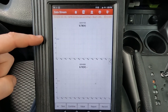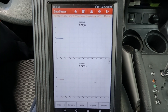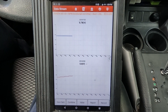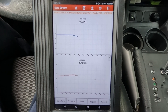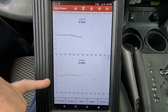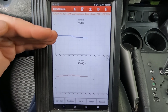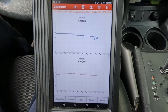Right now they're right where they should be at idle. Let's graph this for a visual. We're at 0.78 volts on top and 0.74 volts on the bottom — perfectly within range. Nice and flat. Let's go ahead and give it throttle, right around 2,000 to 2,500 RPM. It's okay if they drop just a little. We're really just looking for the waveform — we want it as straight as possible. This one's getting kind of more slanted down, but still fairly straight. Starting to dip a little, starting to oscillate a little.